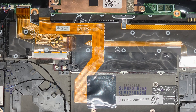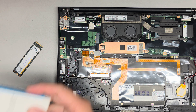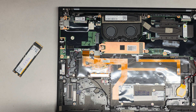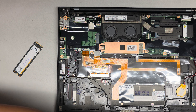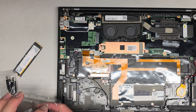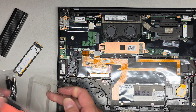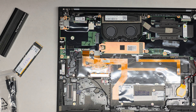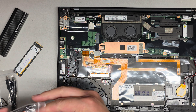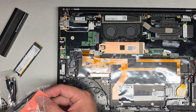So I tested it — it works, but it's encrypted. I'm going to have to help the customer unencrypt the drive. Usually if you know your Microsoft account it's pretty easy. You just log in to your Microsoft account — if you see that blue screen showing BitLocker encrypted, it gives you the website and steps to get the recovery key so that you can access the drive.